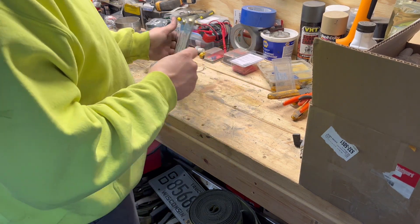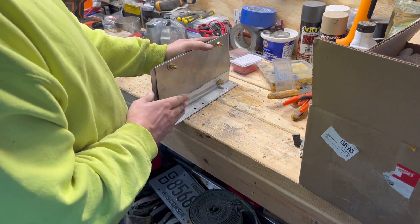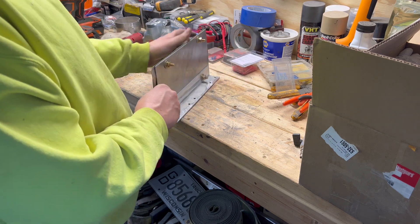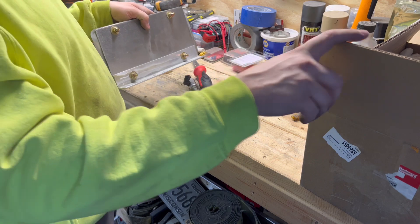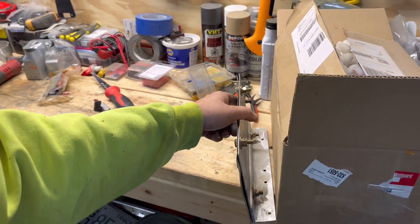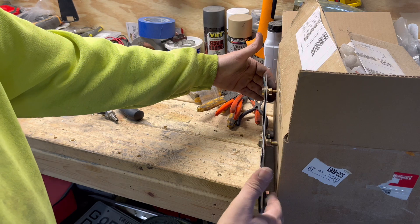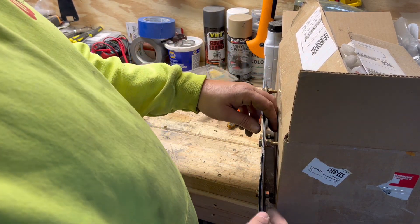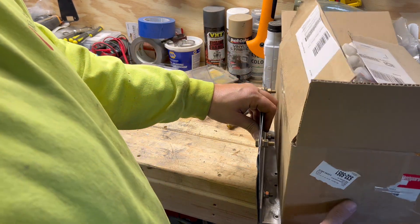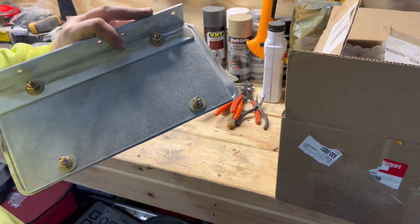As you can see, it was just that easy. This is the general idea. I might nip these bolts off a little shorter if they're going to be a problem — it might be a bit tight. The bumper goes here, and this gives us our space for the oversized sign to come down behind without blocking the plate. It actually makes a little trough, so if wind gets underneath the front of your oversized sign, it can't blow underneath the truck either.